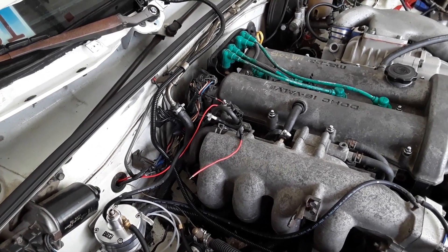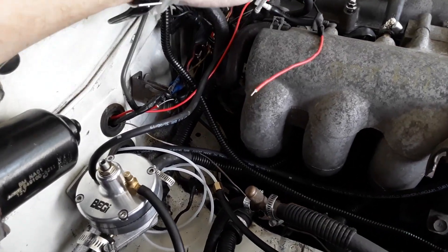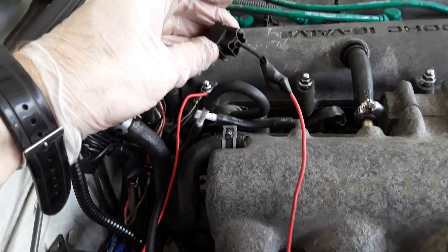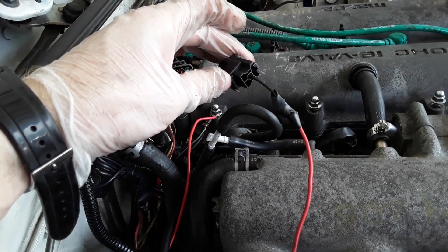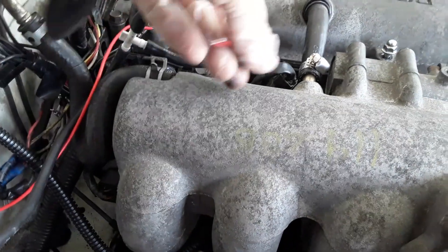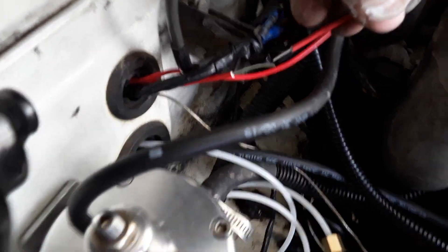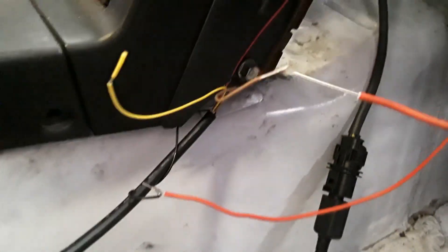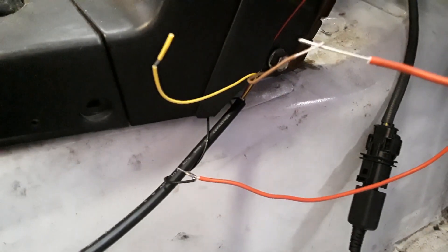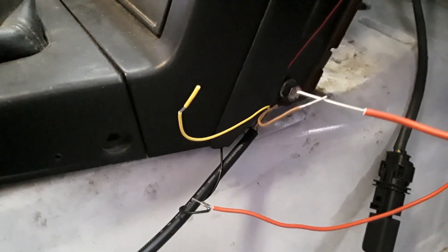The new O2 sensor is installed, but now we need the signal from the O2 sensor to get to the ECU. We've already chopped the old O2 sensor wire — this is the original stock wire connector with a bare end, and that bare end is going to connect to this red wire. That red wire follows back to the interior to the LC-2, where it connects to the brown output, because that brown output and sensor connect the new O2 sensor to the stock ECU.